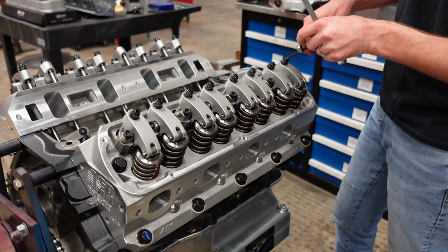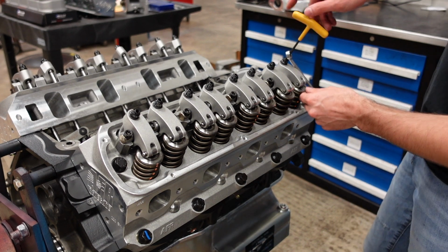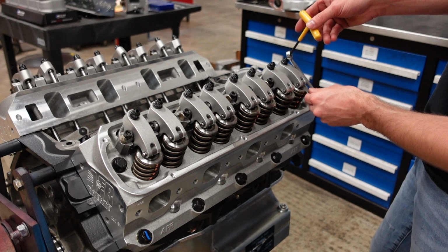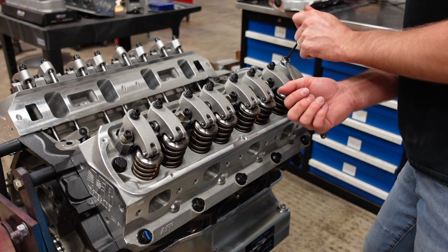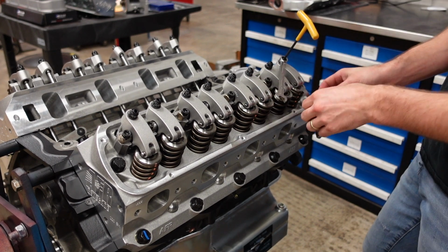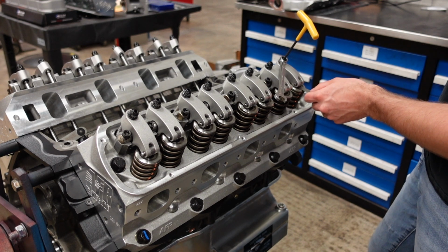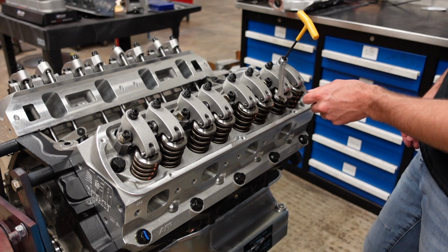Next, we'll insert my 6 thou gauge, and we'll start to run down this adjuster nut right until I feel it start to touch my gauge. And then we can lock it just a little bit with that wrench. And you should have nice, even resistance, no extra slack, and not super tight that you have to force it out and force it in.